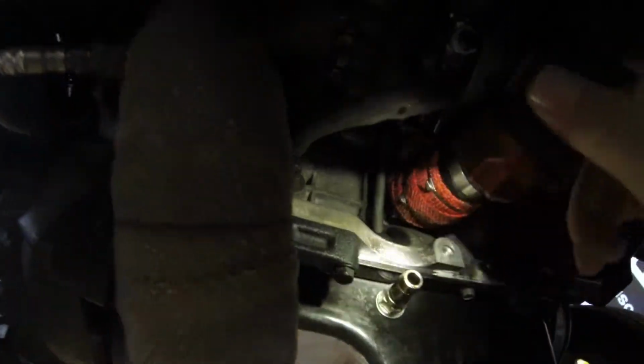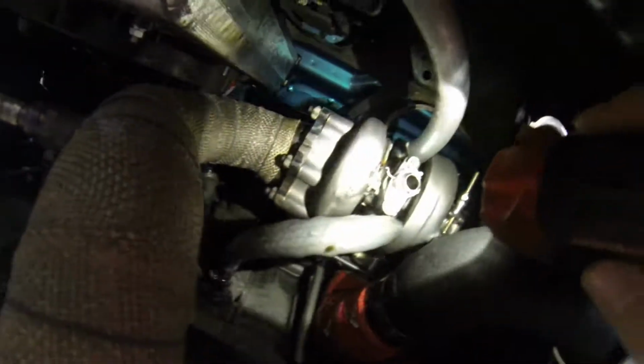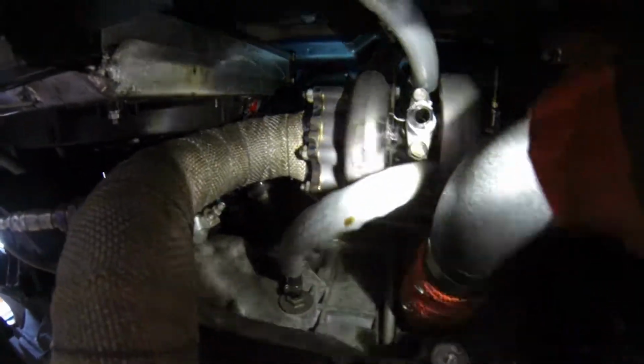So the oil return is lovely and clear. The oil return there is lovely and clear. Look at that oil. What's it coming from, Marsh? I think I'm going to add the oil restrictor, because it's just too much oil. Because when I'm on two-step, obviously the car's not moving, we're looking down. Flooding. Like, this line here is just solid of oil. Which is telling me it's too much goddamn pressure. I'm going to order that, and I'm probably going to put the fitting on the sandwich plate. All I can think.